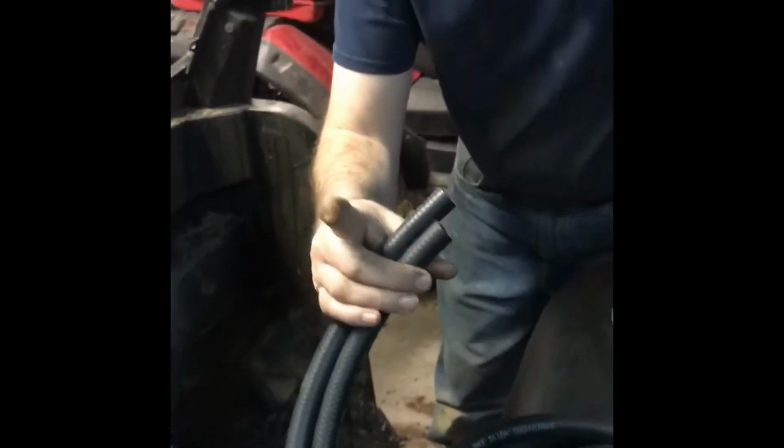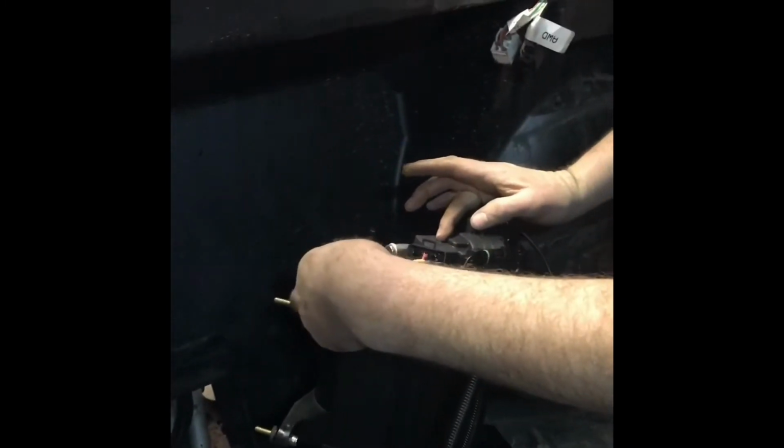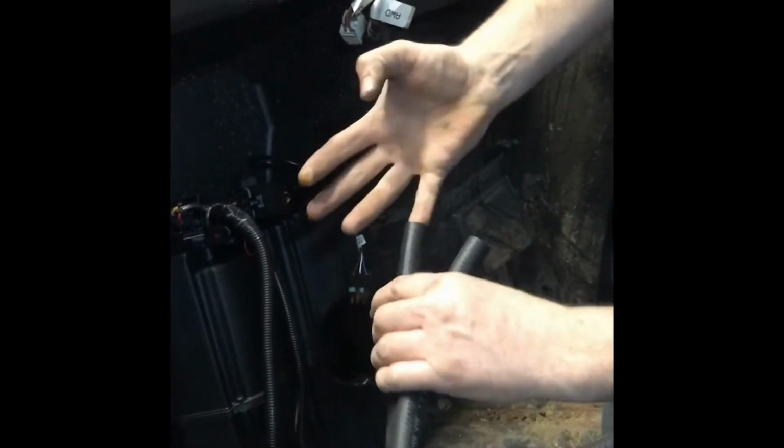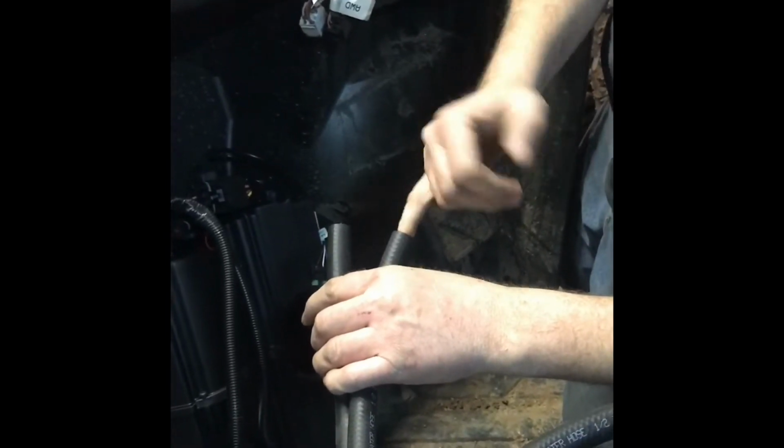Just a little grease or oil or anything somewhat slick, and I always look and see what angle I run these clamps, because it makes a difference in getting them tight. So just make it easy. Make sure they're facing you. Get those suckers on there. A little grease goes a long ways. Or spray the Blaster penetrating fluid. That stuff works awesome to slick these up and get them to where they go on with ease.